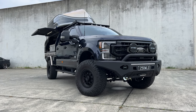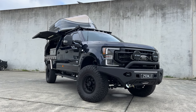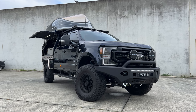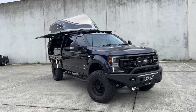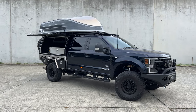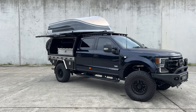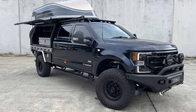We have put a one-inch packer in the rear as well that matches up to the airbags. This is 37-inch tyres. It fits really well. It's a very practical height for these big cars. They can become very tall and top-heavy and balloon-y on the road when you start jacking them up too high. So the perfect number is a two-inch lift kit, but the 37s fit it with ease.